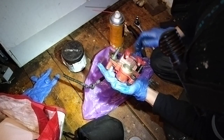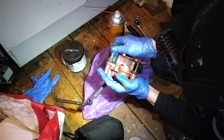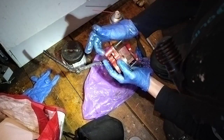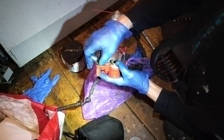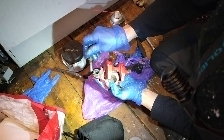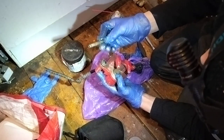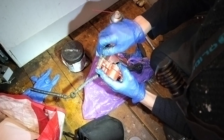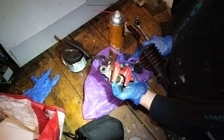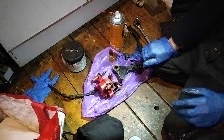I didn't know if it screwed out or pulled out. Thankfully my friend donated his so now I know how it's meant to move - because mine was locked in place and just wouldn't budge. Because there's rubber there, what I might try is heating that area or getting some fluid down there. Some good heat on it would break any seizure normally, and I should be okay putting some fire there carefully.